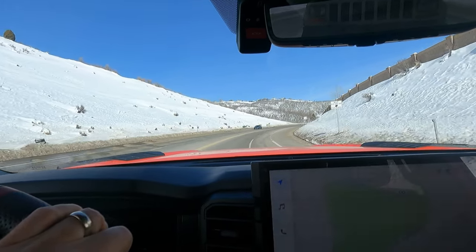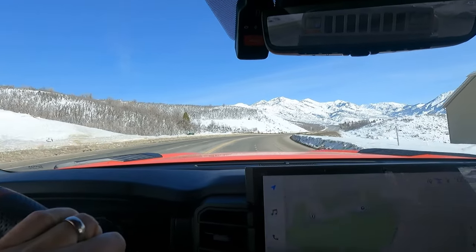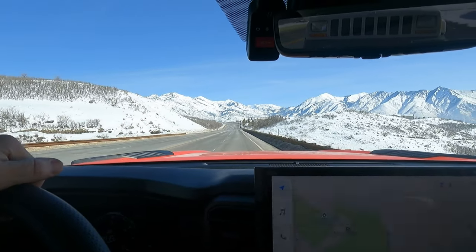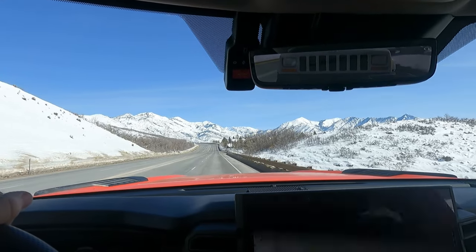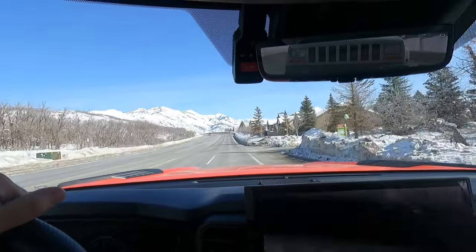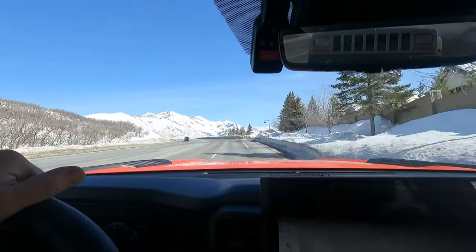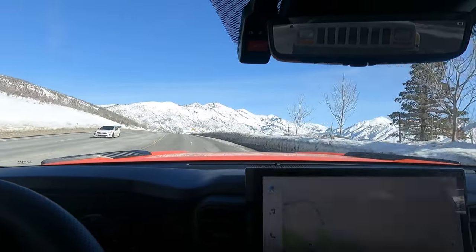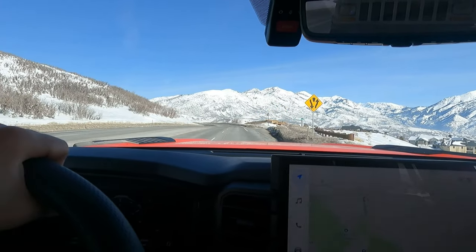You're burning a lot more fuel in these twin-turbo V6s when towing under heavy loads, versus using V8s. Going up this hill I'm getting like 3 or 4 miles per gallon. I'm not going to have a good fuel mileage estimate on this — I'm not doing a full 100-mile fuel test like I often do. But I did want to get a towing feel in. We're at 8,000 pounds using a scale ball mount. This thing really should be using weight distribution when you're over 500-pound tongue weight, and we're right at 800-pound tongue weight.